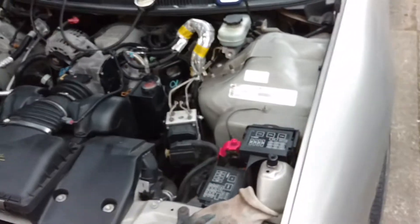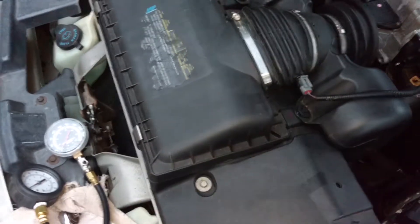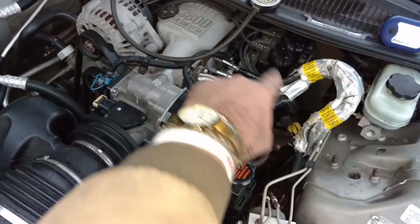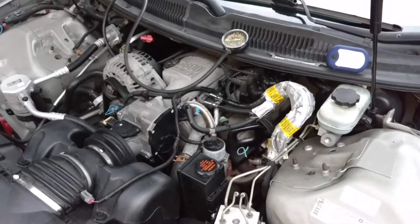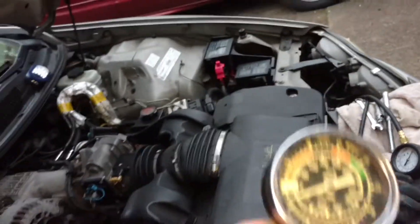We swapped spark plugs. I also blocked off the intake to see if it was running lean, because these DTC codes keep talking about vacuum leaks. I've sprayed stuff all around this engine back in there and couldn't find anything — no indication of a lean condition. We checked vacuum over here and got 14–15 inches running — that seems good too.